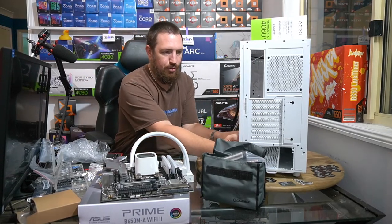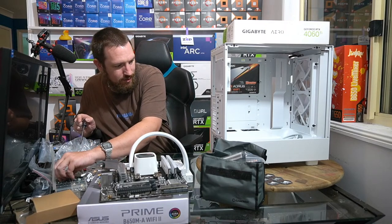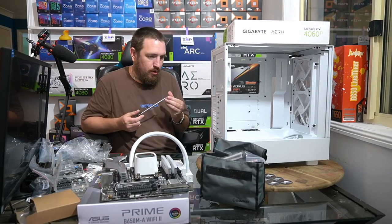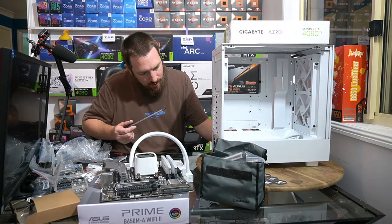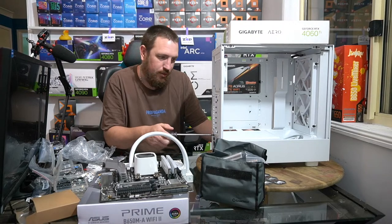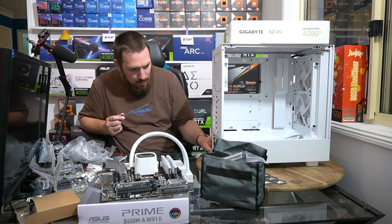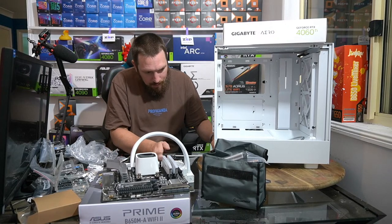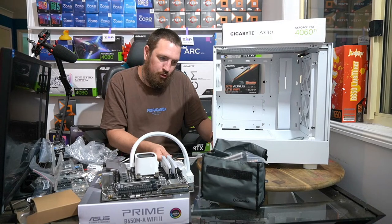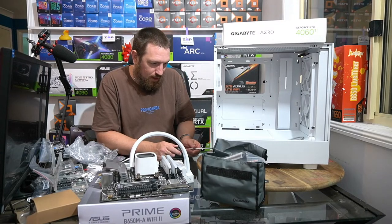Power supplies get mounted with the fan down, because it's good to have them as an independent system that's not impacted by the heat in the rest of the case. Power supplies will shut themselves off if they get too hot, and they'll shut themselves off at temperatures below what the rest of the PC can handle. So if you have the power supply drawing air from within the case, you could end up with a situation where you're just gaming or doing whatever and your computer will just turn off. Put it back on after it turns off and nothing will happen. You'll just get a dead system.